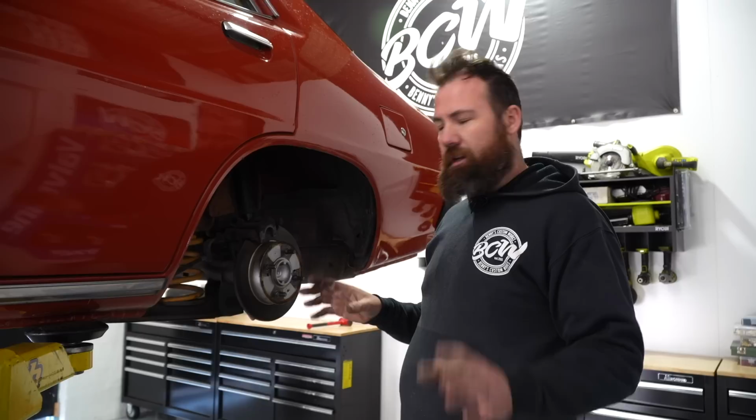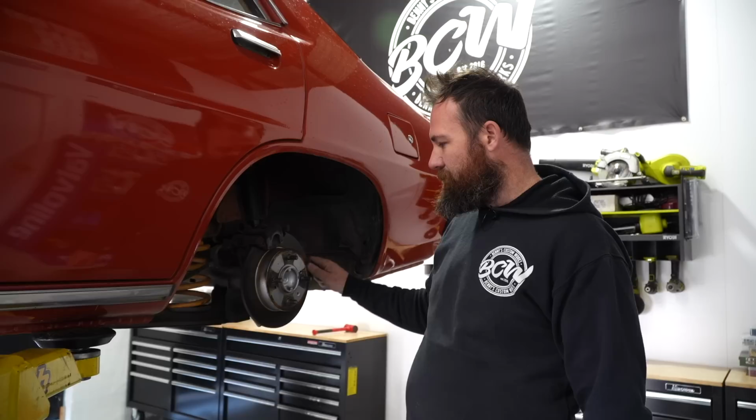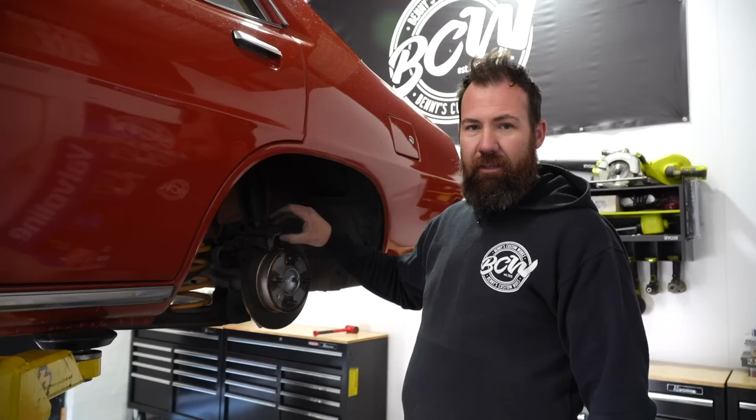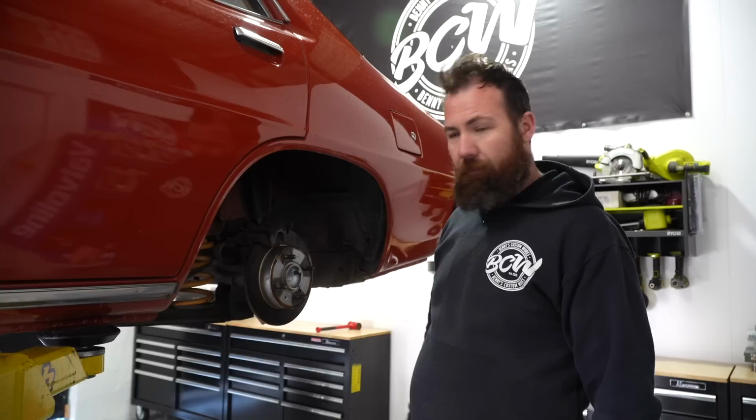But interestingly, the consumables, both the disc and the pad, are the same as S13. The disc's just a standard disc, but we were able to get a pretty good little performance pad for it. So, massive difference in braking, and also, this caliper, much like the S13 caliper, has an integral handbrake. While not good for handbrake turns and that sort of stuff, it's a perfectly functional handbrake for a car. So yeah, you can lock it up, no worries when you're parking the car.